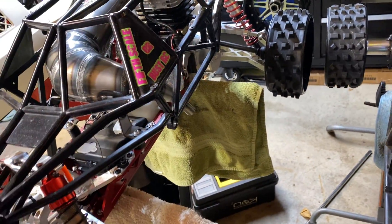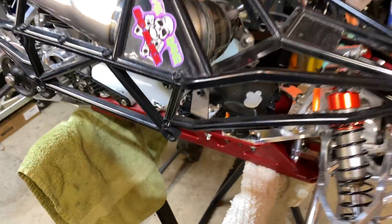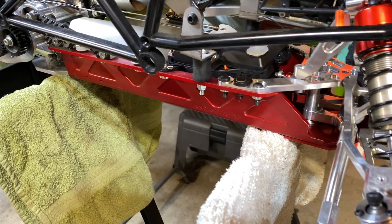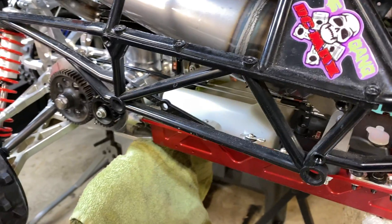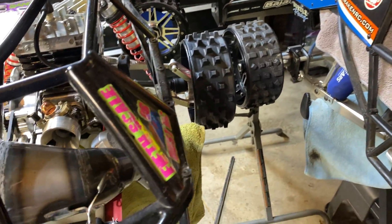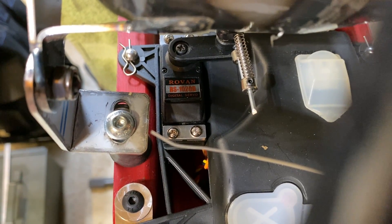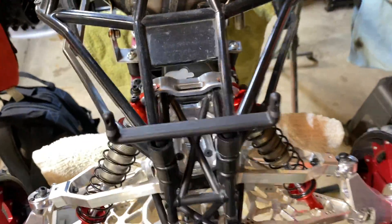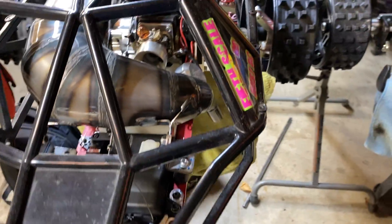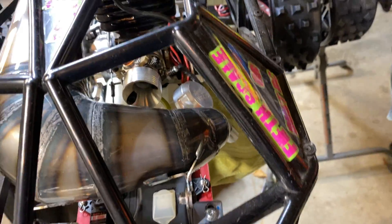This is my 65 Supreme, so this thing should be a monster. It's got the red IRC chassis. I think the gear ratio was like 26-something — I'll have to look. For a good budget fast throttle servo, that Rovin right there is fast. I'm really surprised even with a nickel metal hydride battery. She's pretty much almost ready — just the fuel lines, kill switch, and filter to go, and the end points are already done.